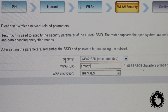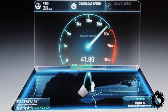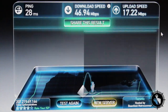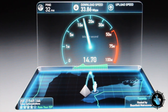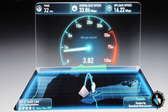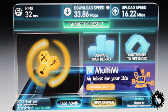You can also see lots of different information about your modem here. I tried a couple of speed tests with good results. With a wired connection, I got an average of about 47 megabits per second download and 17 megabits per second upload. With a wireless connection it was a bit slower — 37 megabits per second download and 15 megabits per second upload. That's faster than many landline connections.